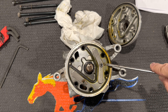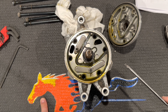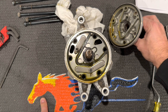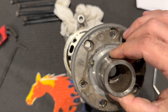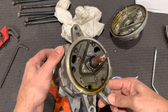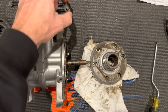This particular gasket that surrounds the front valve can be replaced. You'll notice it has an F on it — that denotes front. The back one will have an R for rear. That helps you determine which is the front because they're somewhat identical and easy to get confused. Now we're going to clean this up and pop the seal out using that tool, or simply use a socket of the right size to knock it through. This particular shaft seal — clean it up first, then simply grab it and work it off the shaft. Without too much fuss, we're able to wiggle the shaft seal off the shaft.